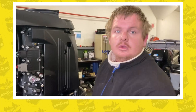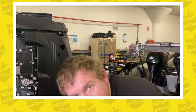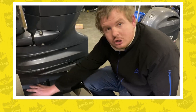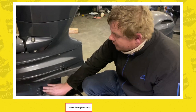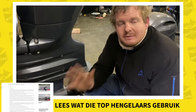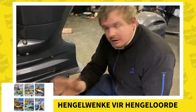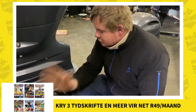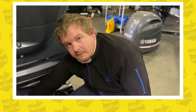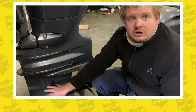If you need to start the engine, rather use a set of earmuffs. Attach the earmuffs to the gearbox, covering the vents. Note that high-performance Sportsmaster gearboxes require special muffs that must be ordered separately. On older motors with side pickups, attach the muffs to the side pickups. Turn your tap on to full pressure, then you can start the motor and let it idle for two to three minutes maximum. On some Mercury motors that have a double intake, you need to be advised by a service technician on how to flush it correctly.